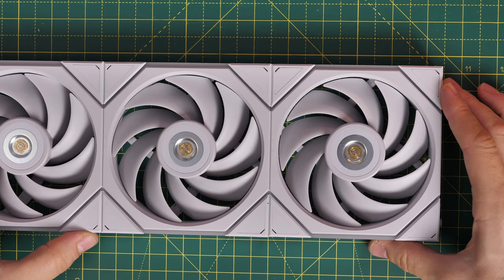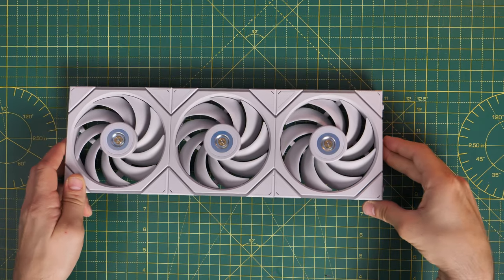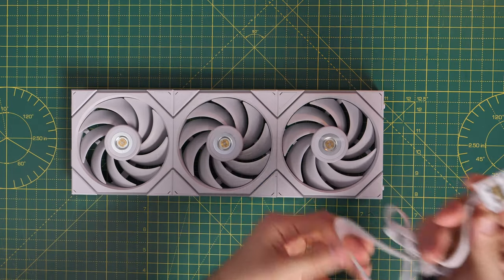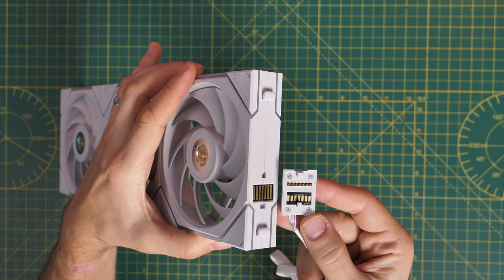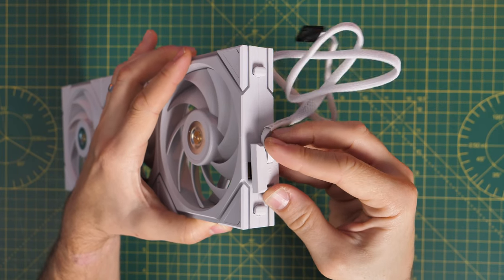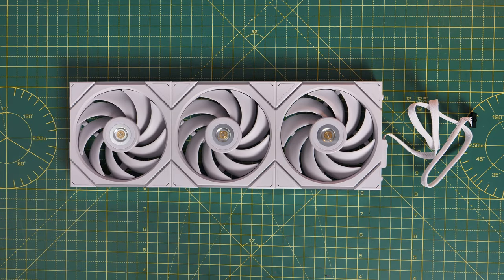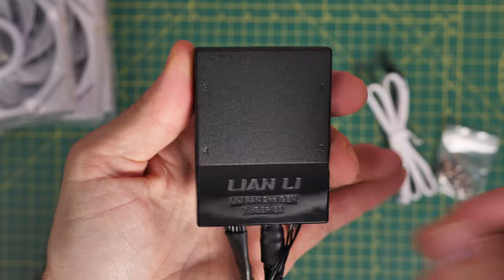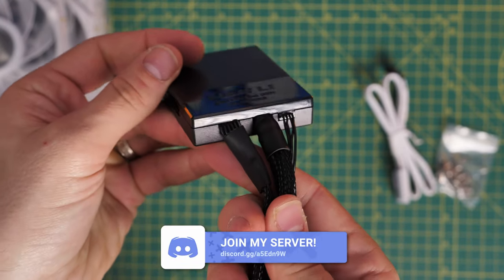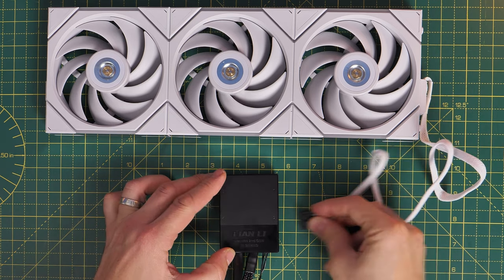They all have zero RPM mode and will spin up to different speeds depending on whether you've got standard fans, reverse fans, or LCD fans — I'll leave spec details in the description. With the TL 120 fans you have the ability to connect multiple cables. The standard cable has both female and male connections on it — pins and flat metal connectors — so you have a choice of which way round you plug it in. That's pretty nice when building as it lets you neaten things up. The cable then plugs into the control box, which has four flat connectors on it. The cables are connected to the bottom of the controller and are non-removable.